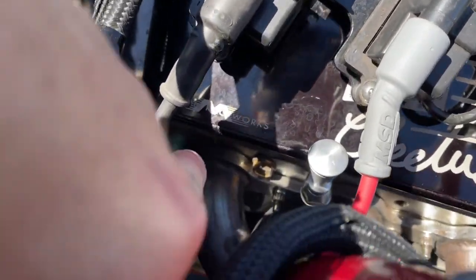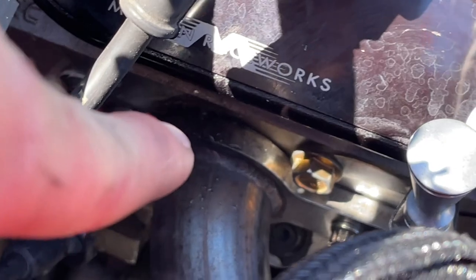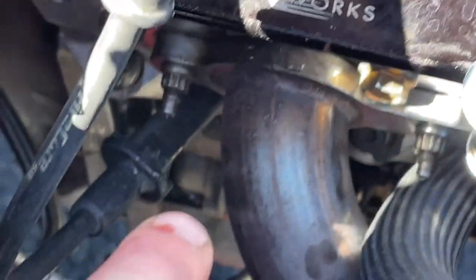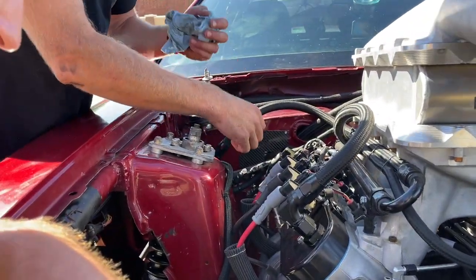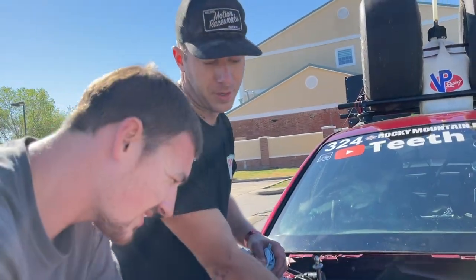If you can see down in here, we're getting water condensation coming out of this header, which is probably exaggerating the oil down there. I bolted it back and screwed it back in — I think that bent the header flange so it has a gap there.